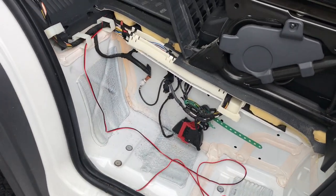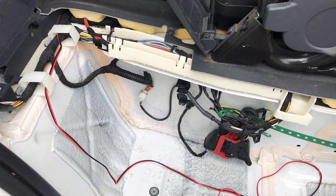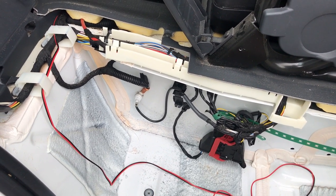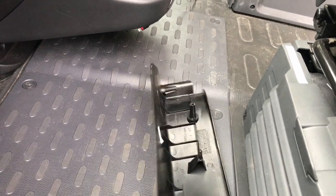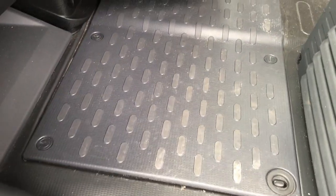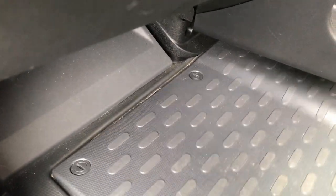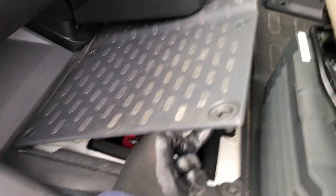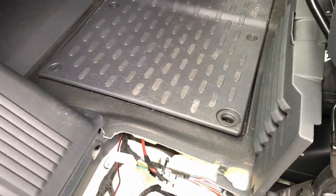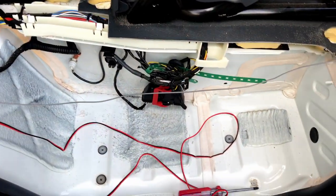Having done that, you now have access to a hidden screw there, and four below, and you're able to pop this panel out. Inside there are some cables I could test, but I don't want to disturb the original electrical cables - I want to run my own. Finally, remove the plastic cover over the battery compartment by unscrewing each one anti-clockwise. It's hinged at the back so it won't fully come out - just get enough working space to run your cable through.